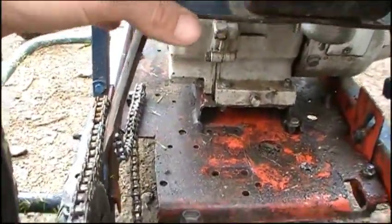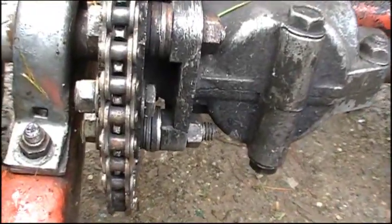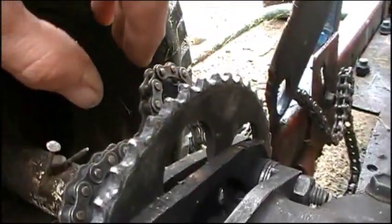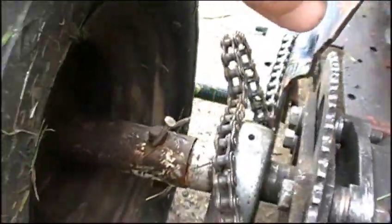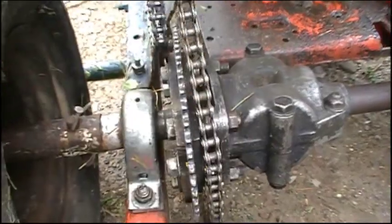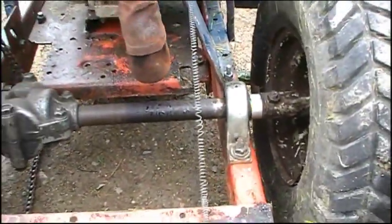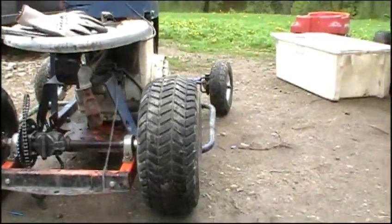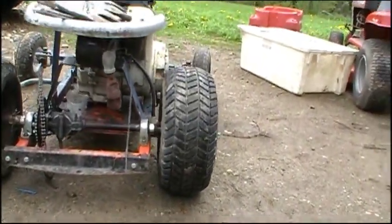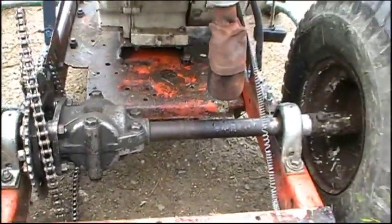You can see the other side of the seat — bolt is missing. Here's the sprocket setup; there are a lot of spacer washers and what looks like a custom plate on this side. The bearings are actually not bad — a little loose but decent. This whole three-quarter-inch axle setup is going to get replaced with a one-inch full-length 36-inch axle. The wheelbase difference between front and rear looks stupid, so I'm going to widen the rear end out to match the front. Bearings, sprocket — it's all getting replaced, and it's going to get brakes.